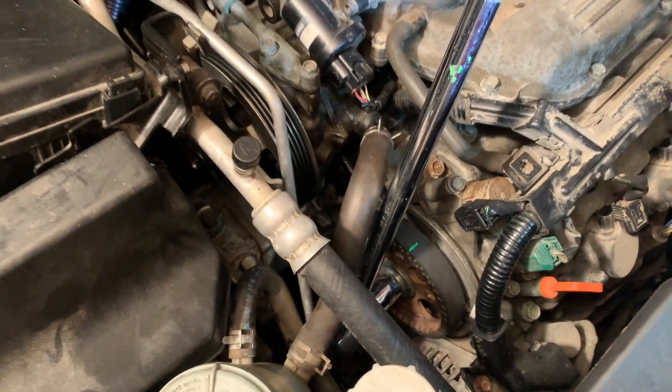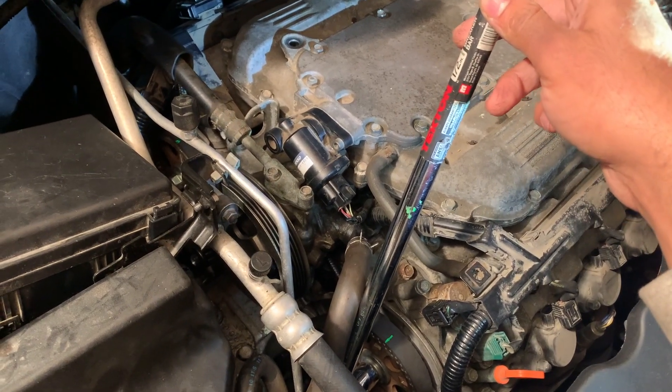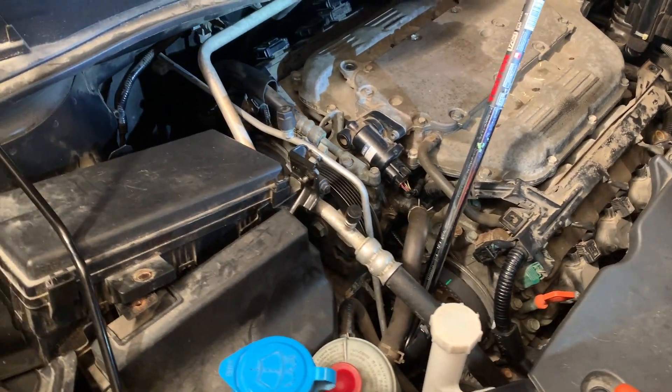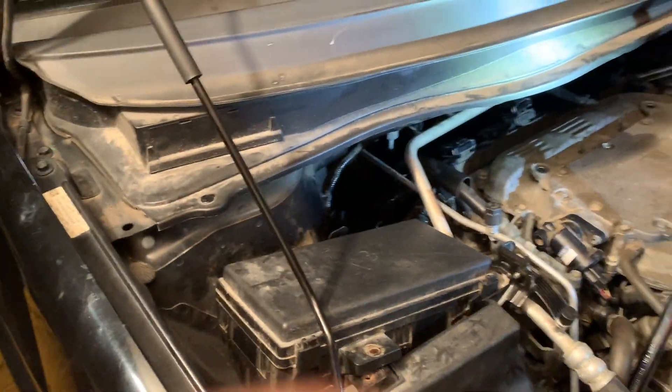Be careful using a socket or your hands to rotate the cams, because sometimes it can cause it to really move a lot. You've got to be very careful doing it this way. Let's get the belt back up, tension it, and see how it looks.